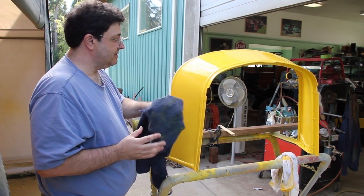The runs are gone at this point. It's just dull and we have to bring back the shine. So I'm going to hit these little spots with 1000 and then 1500. One of the reasons we're doing this by hand is because the hand's motion on a flat surface is really what you need to do to make it flat. I'm only taking this to 1500 at this point.